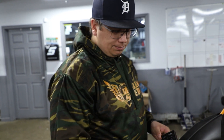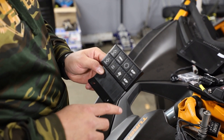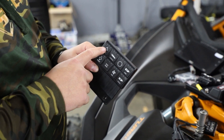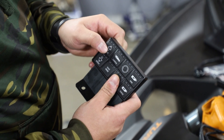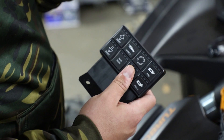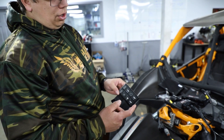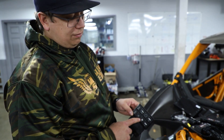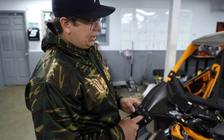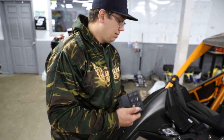To round it off, we have a simple eight-button CAN pad — they also make a 15-button CAN pad. If you want to on the fly, we can increase boost pressures. There's a starting button where there are no lights on; you press the button and one light comes on, two lights, three lights. You can make up to eight positions out of one switch. You can activate launch control, clear codes, override fans. There's a million things you can do — whatever could be controlled by the ECU or the PDM can be done through this.